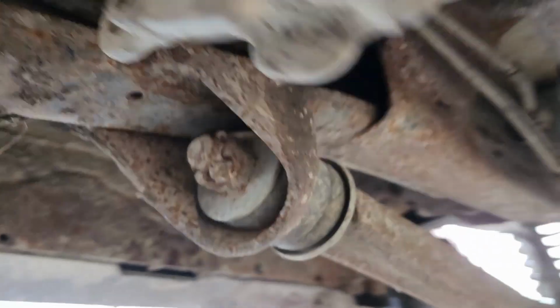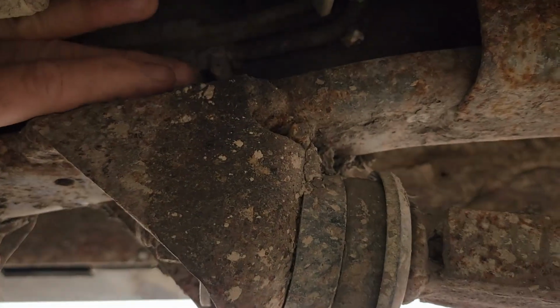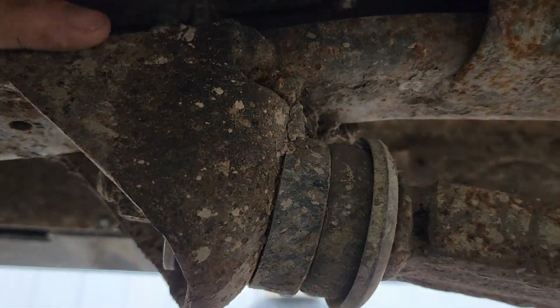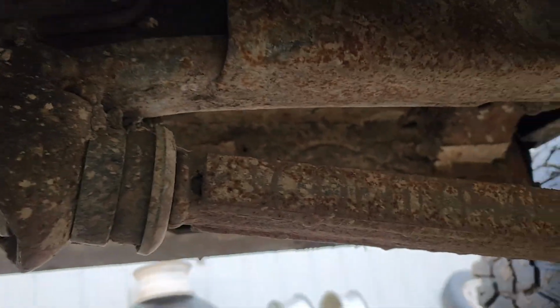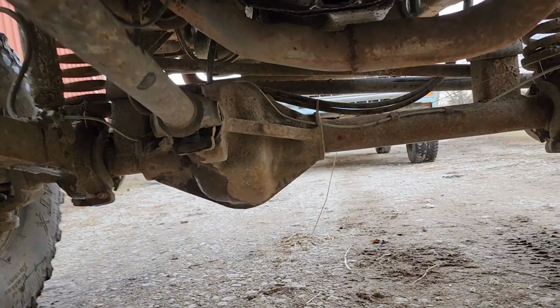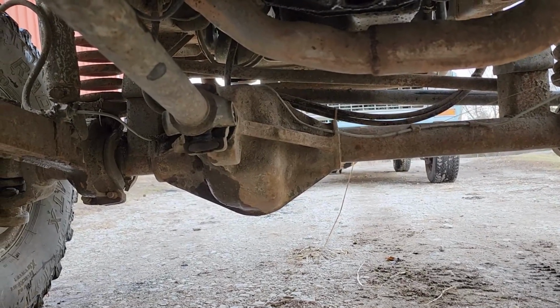I couldn't box this side because I had to have access to the fuel lines and whatnot, so I had to just trim the van mount down and weld it to the frame right there. Doesn't seem to be a problem. The front axle is geared 4.10s. It's open, with no limited slip or locker in it yet.